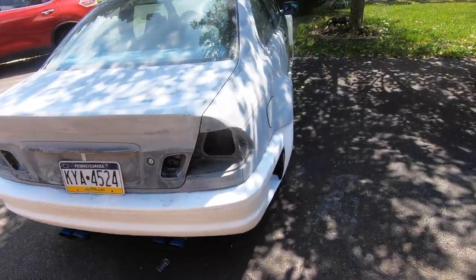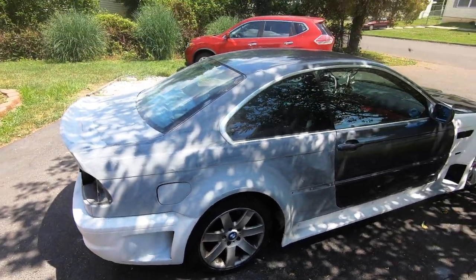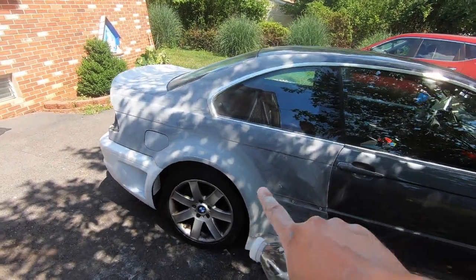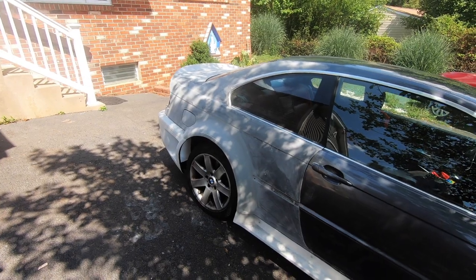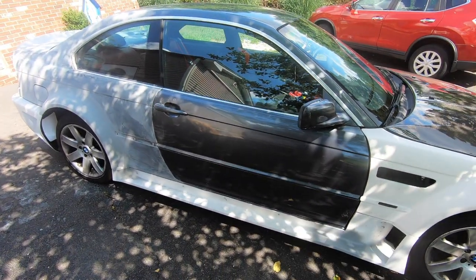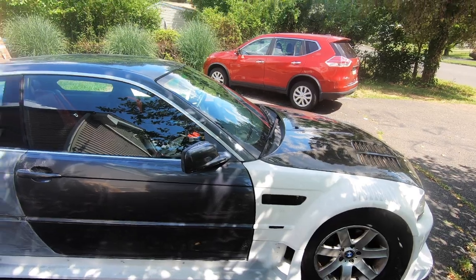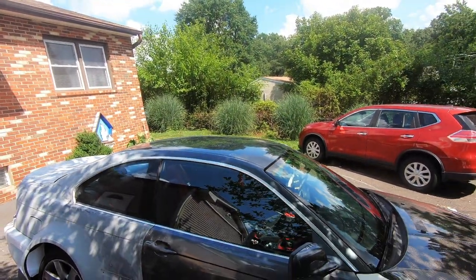I might sand the bumper a little bit and spray it, but there's a lot of imperfections I can see. The body right here is pretty much done. I'm gonna spray this whole thing in primer and I'll actually get a sense for how I molded the rear. I'm hoping it's gonna be smooth. I might buy enough cans to spray the doors as well today, maybe up to here because I don't have anything to cover my hood and I don't want overspray on it. I might also do the roof because there's a big dent I want to get out.